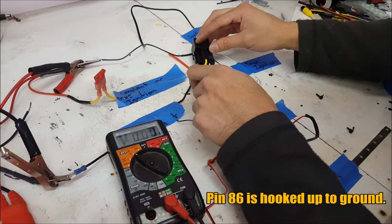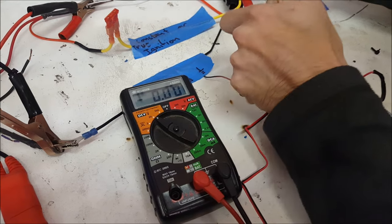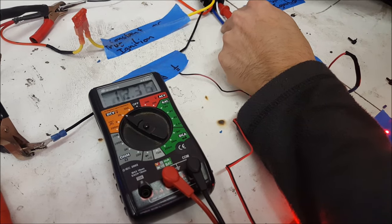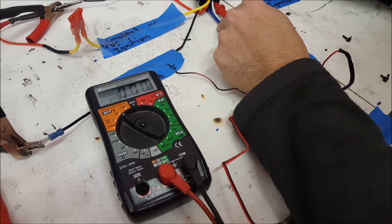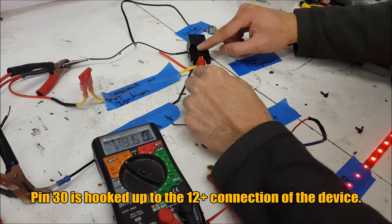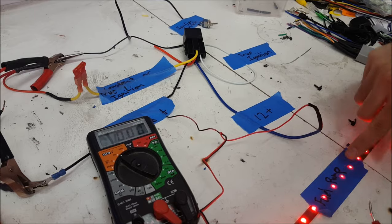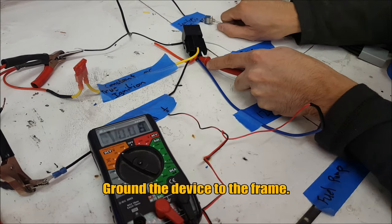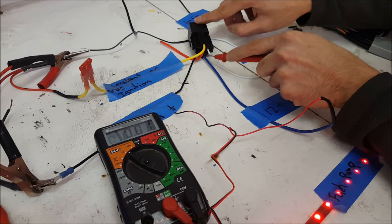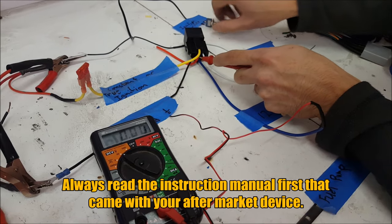I have pin 86 on ground right now — it's black, so it'll be easier to remember. Put the multimeter in and you see the negative sign — that means we have ground. Take it out, it goes away. Now our switch is off. You can see I am showing ground — now I'm going to flip the switch on. We have 12 volts, and you can probably hear the click. If you put your hand on it you can actually feel it do something. So right now we have pin 87 at 12.3 volts, and pin 30 the same — and you can see my fuel pump is on right now. Watch pin 30: I turn the switch off and it pretty much goes open. Turn it back on. So you're just connecting these two — connecting 87 to 30 by having pin 85 get 12 volts and pin 86 get ground. Turn it off and the whole system is safe.